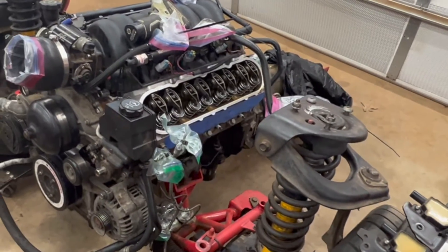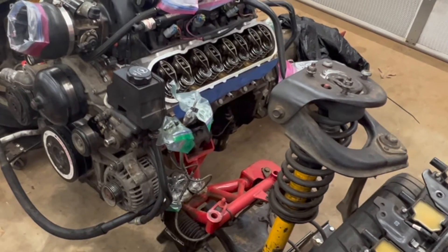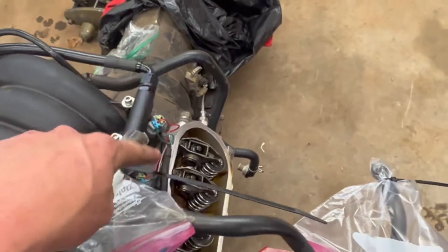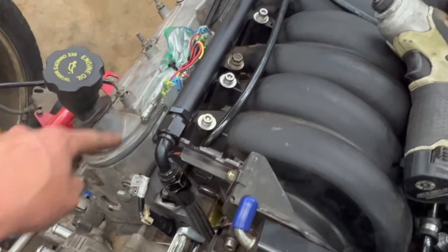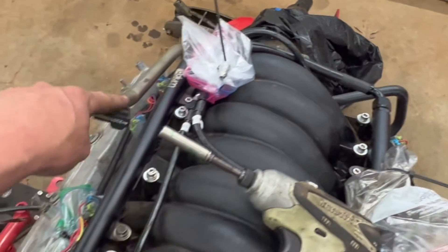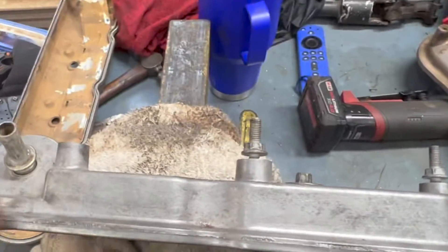So now we have the 4.8 — it's not a daily driver, it's a weekend warrior street strip build. It had me curious: if this thing has an internal PCV valve, then my catch can isn't doing its job. I need it to ventilate straight into the catch can. I have two hoses coming around and entering the catch can. So I'm thinking this valve cover might not even be doing anything.